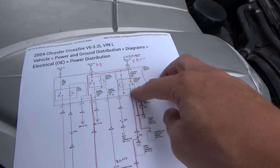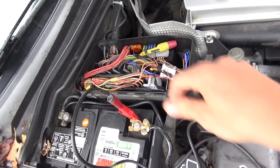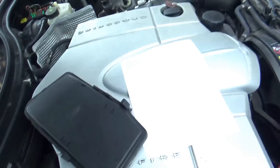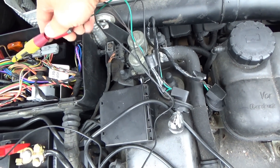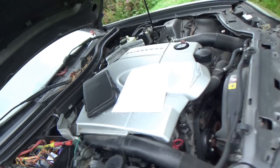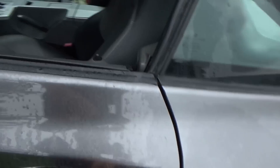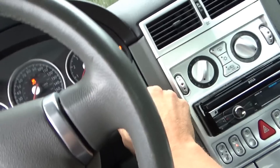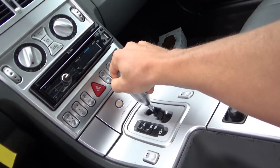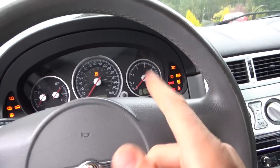We know it's on a 15-amp circuit so it's designed to carry some current. I want to use a 5-amp test light from battery positive and feed that right into the back probe. If it's shorted to ground it would have blown the fuse — I'm sure it's not shorted. Test light did not light up, but let's see if something changed with the car. Everything is plugged in, starter pulse relays all OEM. Let's turn the key off, then on, and try to crank it — still no crank, still can't shift out of park. Let me get the scanner out and see if any modules came back online.